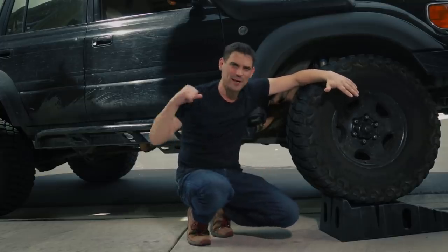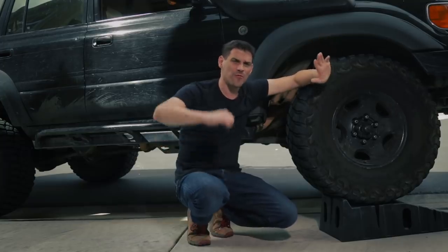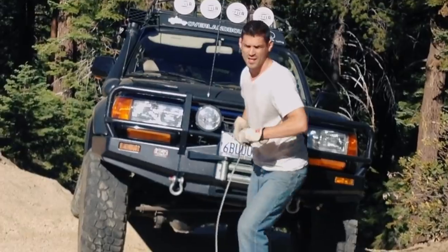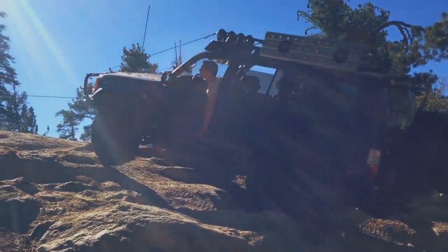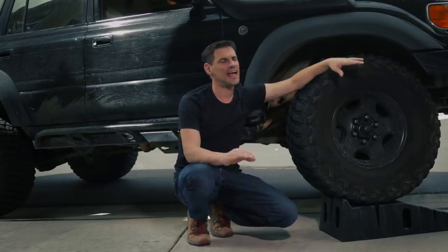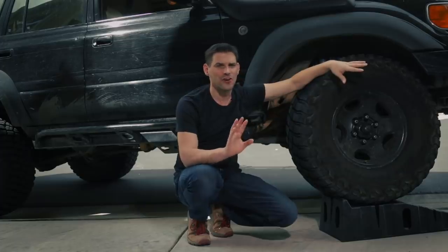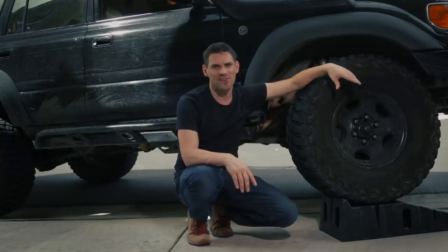The reason I call it a luxury is because that's when you're impacting — that's when you get in a wreck. The other armor is things you'll use just going down the trail. A stout front or rear bumper in terms of impact means something very bad happened. If you get a winch for recovery, most winch bumpers are fairly stout and provide a certain amount of armor on the front. I'd advocate handling armor after tires and lift, and before rack, fuel mounts, lights, light bars, or scene lights — armor prevents breakdowns on the trail.